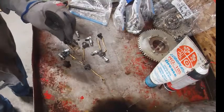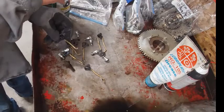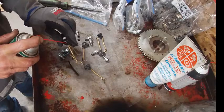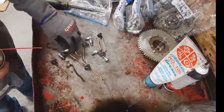Here are our oil cooling nozzles. These are particularly important. If they're plugged, aimed incorrectly, or bent, they won't lubricate and cool the piston. If you look inside here, there's a little hole. What I like to do is take some brake clean and make sure it's nice and free. I've done that on all of them.